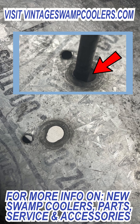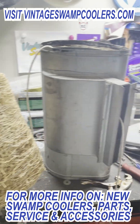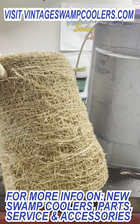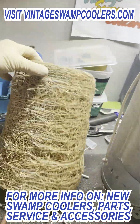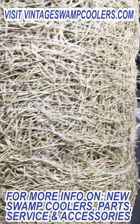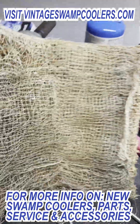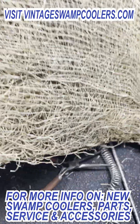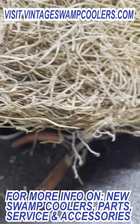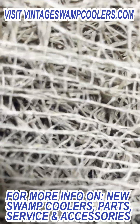Here's that swamp cooler we're restoring. This is the pad that's out of the basket on the inside. I've told you this before but I want to point it out again — if you look at the pad it actually looks like it's in pretty good condition, it's all one color. But what you can't tell is that on the inside there are actually spots with little bits of black mold — see that right in there.